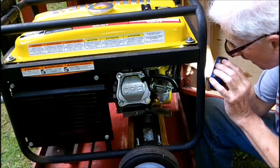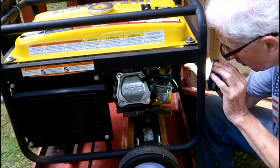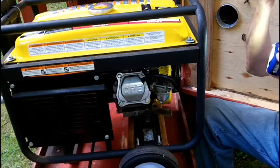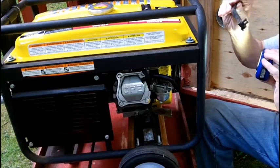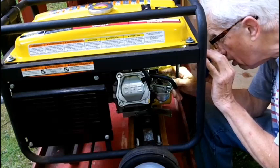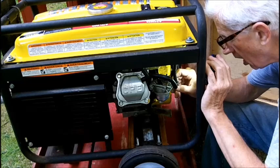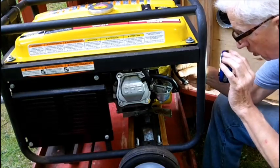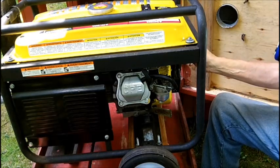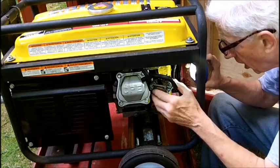Here's the choke lever here. I just want to make sure when I pull that out that I know where it goes, because I have a hard time putting things back together again. So we remove that. The carburetor listing doesn't show this in the listing, but the picture shows this on the carburetor itself. One thing's good — it's not dripping. It only dripped when I first pulled it off, which means the second shutoff cock is not leaking. The original one is leaking, but I would have to drain the gas tank completely. I do have a new one that goes on the bottom of the tank from Champion — they sent that at the same time they sent the carburetor.